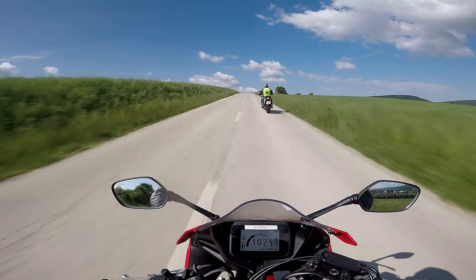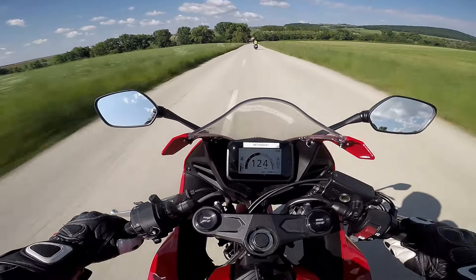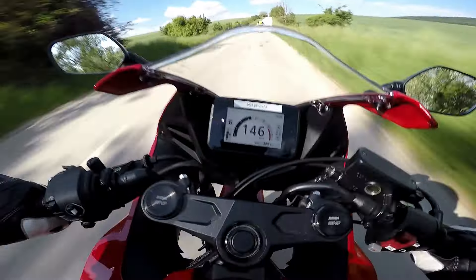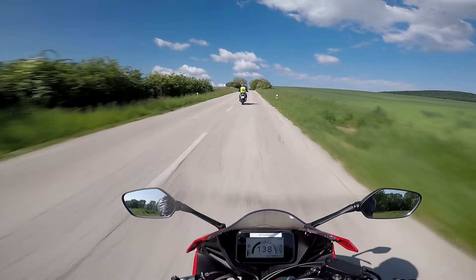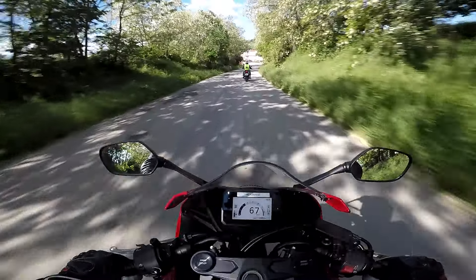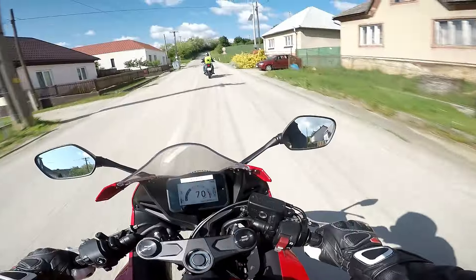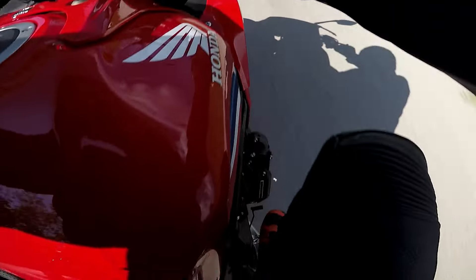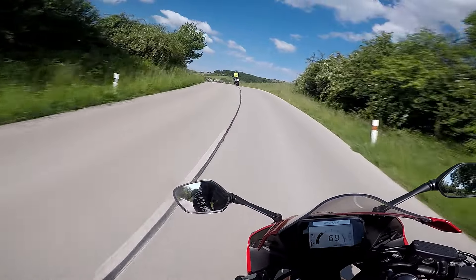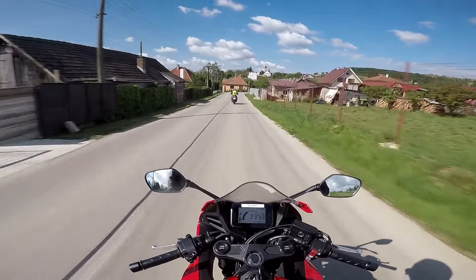A little bit about the bike: this is CBR650R, a four-cylinder engine with 649cc. It has about 70kW, so I'd say something under 100 horsepower — 92 or something — and 63Nm if I remember correctly. We have about 15.4 liters in the fuel tank, which is nicely shaped. Maybe a little bit better shaped up top to keep my leg from sliding all over the place, but it's not a track bike, so that's okay. Also, every time I go for the brake, I kick into the e-clutch — it's a pretty big addition to the bike, size-wise.